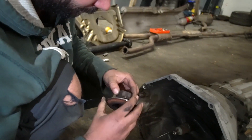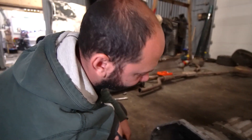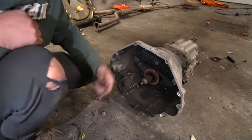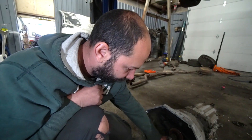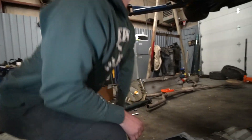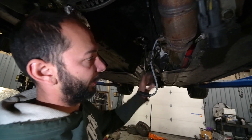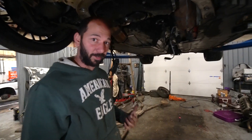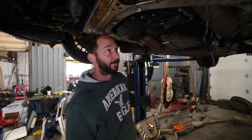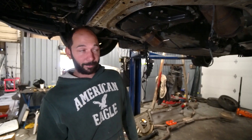That's not in the best shape now. Probably won't replace that — budget build — but it nicked it. And then after it nicked it that first time, those pins just started falling out of the clutch. So yeah, space the slave and see if she gets any better. The only thing I'm slightly worried about is because I cut and rounded it, it's slightly shorter than it was, and that might not work. I'm going to have to order another slave, but we'll figure that out when we get there — hodgepodge it together. I really liked the way that clutch felt when it was in there, and this is an extremely affordable way to have a clutch that will handle clutch kicks, burnouts, and just beating on it better. So we're going to get back on that and see if we can get this thing back on the road.